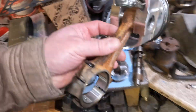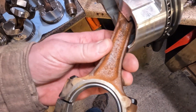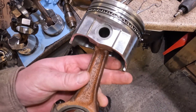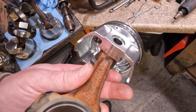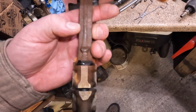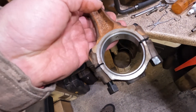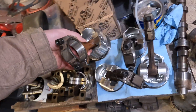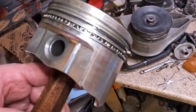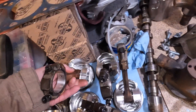Other things we have to correct — look at this heavy corrosion on this connecting rod and all the rust dust in there. I don't know if it's worth the risk to press the pin back off the rod to try to clean it up. It did have ARP rod bolts installed. Hopefully they did the proper job of reconditioning these rods. I'll take it apart later and look, and I'll have to double check the ring gap because I don't know if they gapped them according to turbo specs.